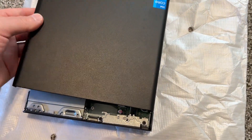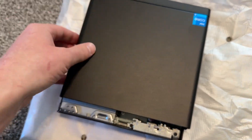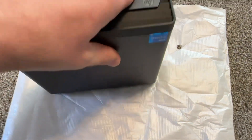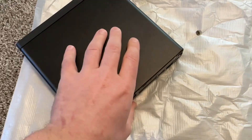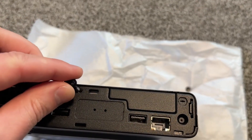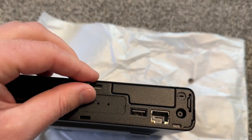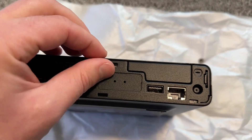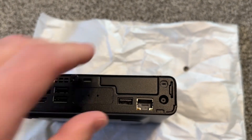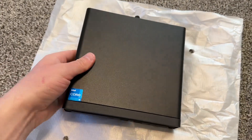After that we just put the panel back — slide it into place about an inch away and then slide it back. Then we get the screw back in there. I did it even without a screwdriver — it's fine. Now we have 16GB of RAM instead of eight.